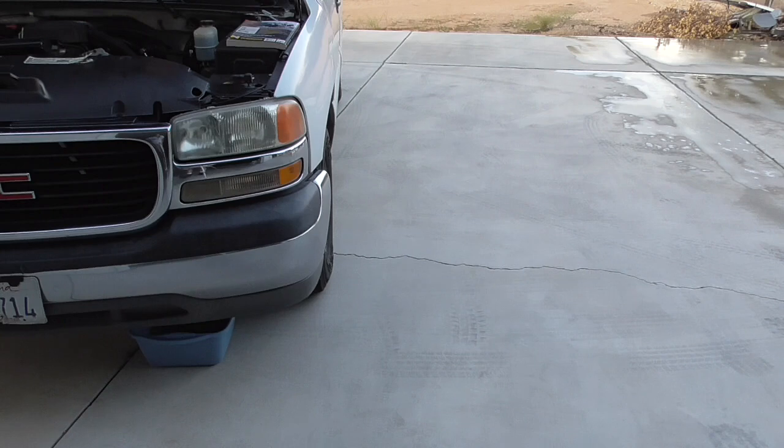As I've been flushing, I noticed a lot of sediment and rust coming out. Initially I thought it was just dirt, but after it cleaned up a bit I could tell it was a stop-leak additive — you know, those powdered copper-type stop-leak additives. Shortly after I recognized what it was, my radiator started leaking. So obviously they used that product to stop a leak, and that's the reason I'm replacing the radiator.